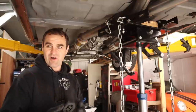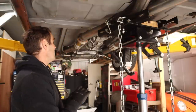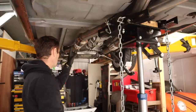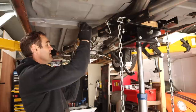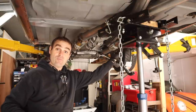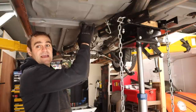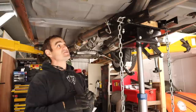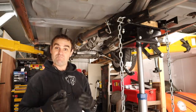Now we're going to make some hangers. I jumped online and got some basic exhaust hangers — I'll put a link in the description if you're interested in something similar. I'd like to put a couple on either side nearer the front of the system, but I want to put them behind the flex joints. On the driver's side there's nowhere further up because of the pedal box, so I'm looking at putting them behind the cat. The cat's going to get very hot, so I'm putting one on either side pulling out in either direction to hold it up. I'm going to get some stainless steel rod and work out how I'm going to weld the mounts onto the car.